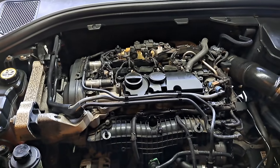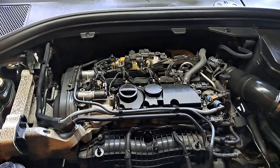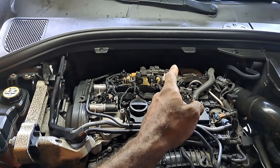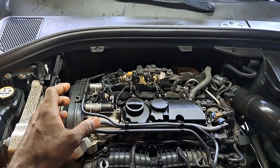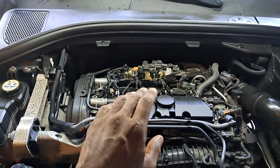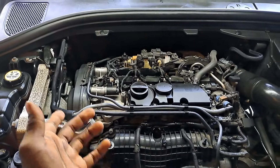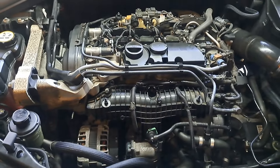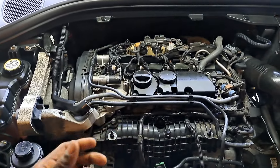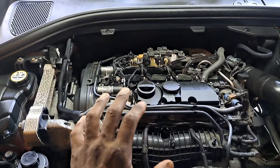As for why I didn't use Seafoam — a while ago I did some back-testing on sludge from a Toyota Camry. I took four different jars and put Seafoam, transmission fluid, diesel, and brake cleaner in them. The only thing that really worked was brake cleaner — it dissolved that sludge to nothing. Diesel worked too, but didn't dissolve it like brake cleaner did. However, diesel actually took that sludge off. Hence, with a port injection system, look at how clean those valves are. Gas is also a cleaning agent, but diesel is thicker, it lubricates, it served its purpose, and we saw that work today over the course of a few days.